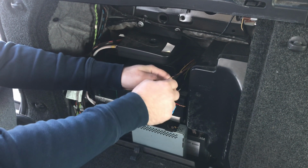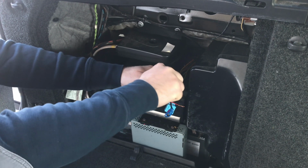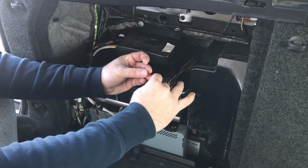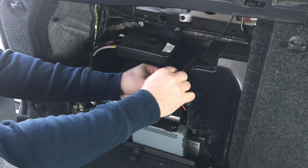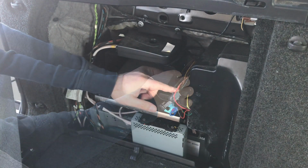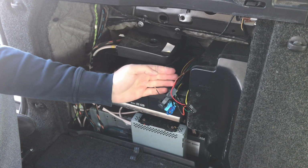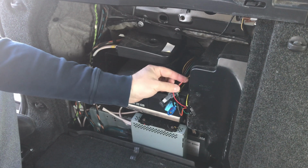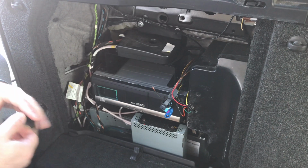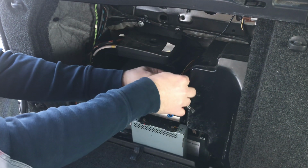You make a hole in the wire, because it's a multi-stranded wire, which means there are multiple strands, and you want to insert this red wire in here and twist it around. So you insert it into the opening. When twisting this wire on, be careful. You got ground here, so be careful not to touch it. This plastic here is fine, but here you got metal, so make sure not to touch this when doing this particular connection. Alright, and then just apply electrical tape to isolate the connection.